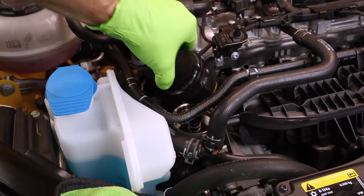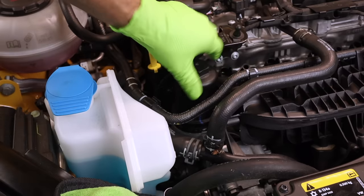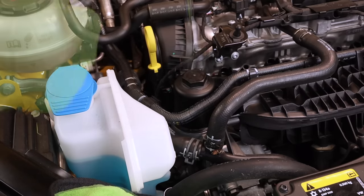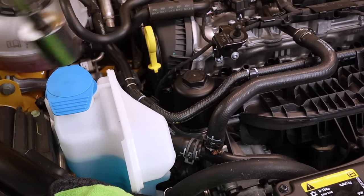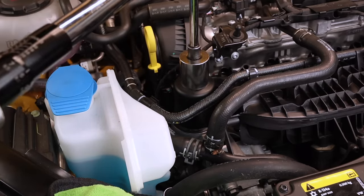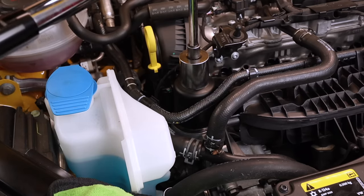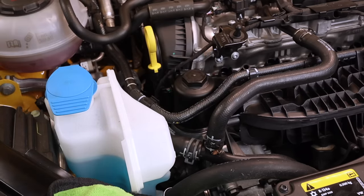So we just take this. We rotate it down, go ahead and snug it up by hand. And luckily, our torque spec is written right on the top, 25 newton meters plus 5 newton meters. I'm gonna do it to 25 newton meters and see how it feels. And we'll go ahead and do another 5. All right, that is torqued.